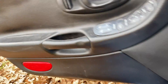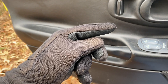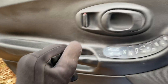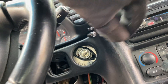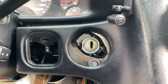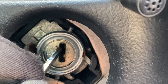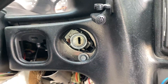The door had cuts five through ten — bitting five through ten. So I had six, seven, eight, nine, ten to work with. I had to progress a lot of keys. It's a single-sided ignition, which means there are only moving parts on the bottom side, so you only have to cut one side of the key.